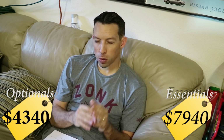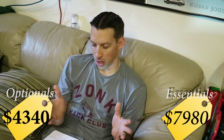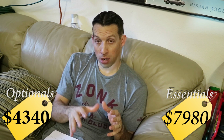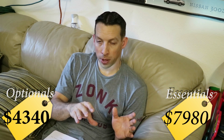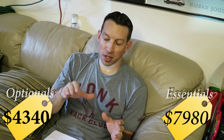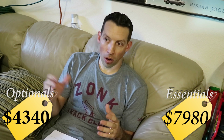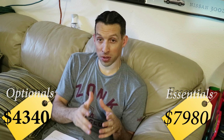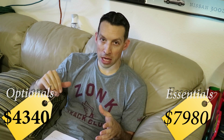Of course, I don't have the receipts on those, but I think it was roughly $40 for radiator hose. That's another thing. The radiator that I bought is a closed system radiator. There's no radiator cap or opening on it at all. Since the radiator sits significantly lower than the engine, all the coolant would just rush right out of the cap. So we have to be able to fill the coolant system at a higher point than the engine itself.